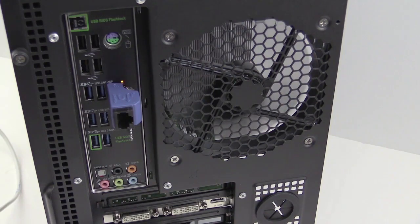So a little bit about the RJ45 loopback. You can use that to find particular cables and what ports they're connected to on a switch, and identify if the RJ45 connection on the computer is working properly. So that's it for this sub lesson.